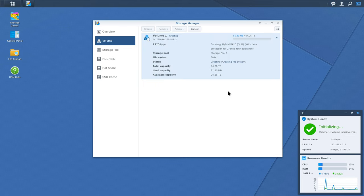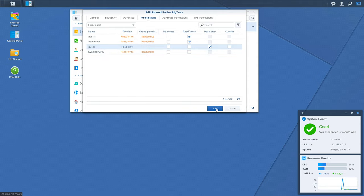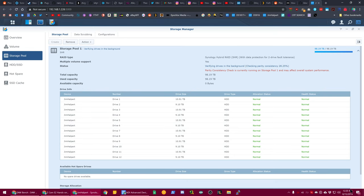You don't want to just run bare RAID 0 and go nuts. I got that set up, created the file share, mapped it as a network drive, and didn't run into major hitches — though building the RAID and doing consistency checks does take a little while, so be patient. Then I installed the 10-gigabit networking card and immediately hit my first problem: I don't actually have any additional 10-gig networking over at my storage server.